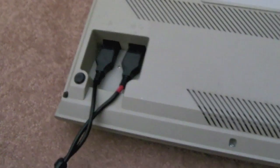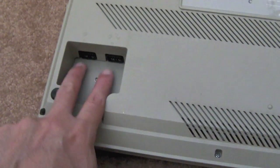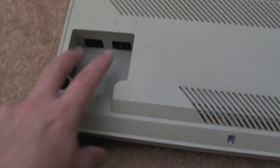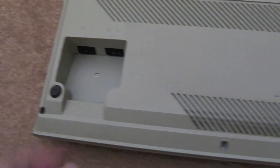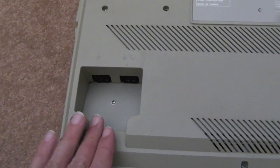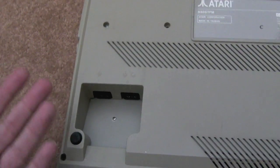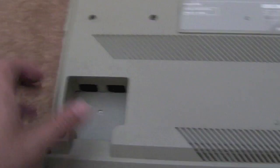In order to tear this down I'll just turn this over. I'll disconnect these extension cables for mouse and joystick. One of the common faults on the ST is the joystick ports and mouse ports — the location is at a strange angle, and when you're pulling the wires in and out it damages the pins. The way they're soldered onto the board, you get dry joints and eventually they stop working. I'll cover that when I get inside.